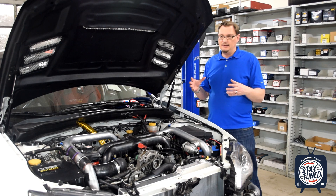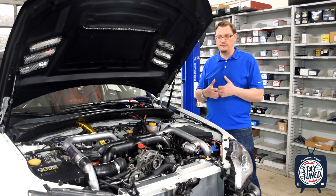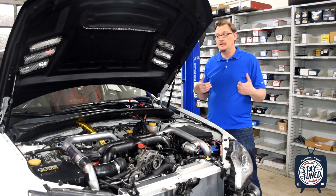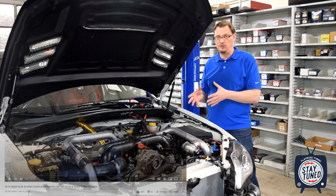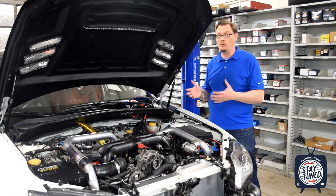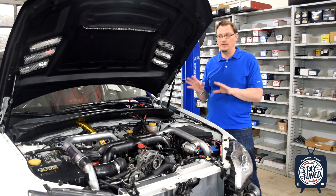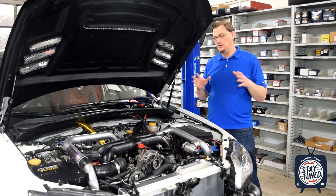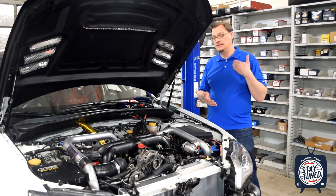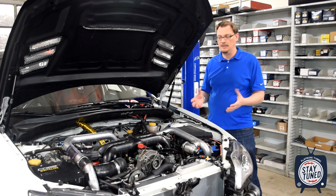The aftermarket separator takes the factory air-oil separator when it's been overwhelmed and increases the volume to give greater capacity, which for most applications works. But when the air separator system or the PCV system starts to break down, it's virtually always related to crankcase pressure building up. The main reason we put a dry sump on this car is because we wanted rock-steady oil pressure going into the engine - we wanted to know that no matter the conditions the car was seeing, whether braking, acceleration, turning, or G-loads, there was always consistent and reliable oil pressure for engine reliability. The second part of that was to remove all the potential issues that can crop up with the PCV system or an air-oil separator, to make the engine more reliable.